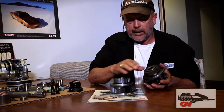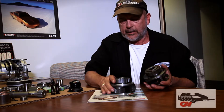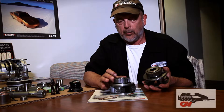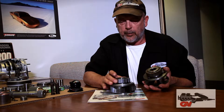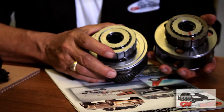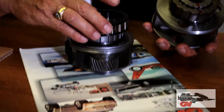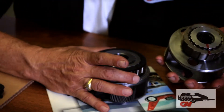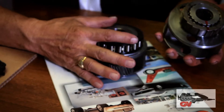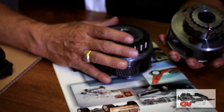The cam is pressed on — in all cases that's a press-fit on the Gear Vendors unit. On the normal non-pro-mod car, when we press this on we use a Loctite that bonds the two pieces so there's no movement, and the roller clutch operating on top of that won't crush the space in between when we launch and hit our 60-foot times, even in a heavy car.